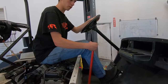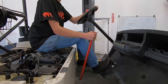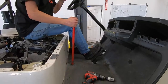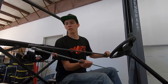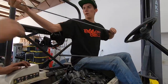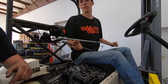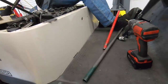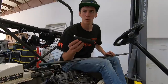We want room for someone else to sit in it if we had two people, so we're positioning it as far over as we can. There's nothing else under this, just sheet metal, so we can drill right through it. For our shift linkage Jamie went and got some all-thread with heim joints, and we got a sleeve to put over that to strengthen it up - it's pretty flimsy on its own but strong enough. Just to be sure we'll throw the sleeve over it and then we know it's good. We also got a handle for the shifter.